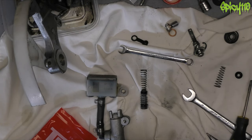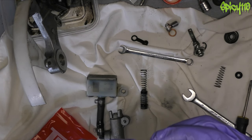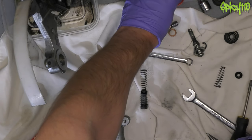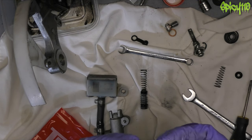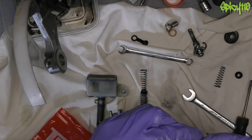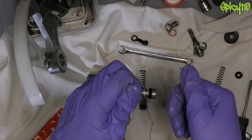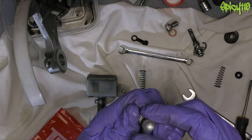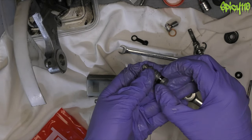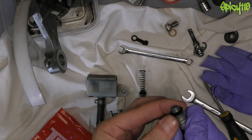I have to get that seal over the top of that. It must do — it's a big difference, but it must go. So plenty of brake fluid for lube. I'll try going that way. It's going. Okay, it does stretch that far — I would never imagine it would stretch like that. Plenty of brake fluid as lube. Get one edge under and just gently bring it over. Seems to work. There we go.